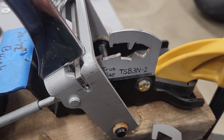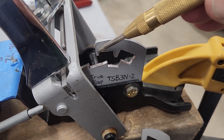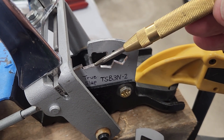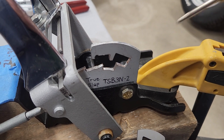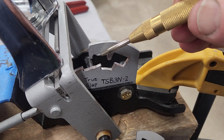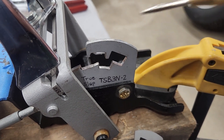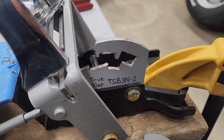The one I made yesterday does not have this stop on it — I actually have a stop down below. It's in another video titled TSB-3N. The stop is down below where the user can squeeze the trigger, pull up against this ceiling here, and move forward so as he gets past the third gear stop, he can drop it down and hit the neutral stop, which is down here on the bottom.